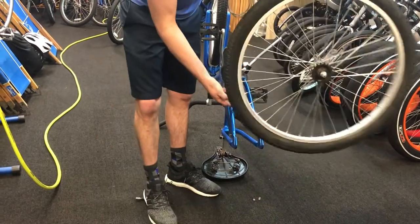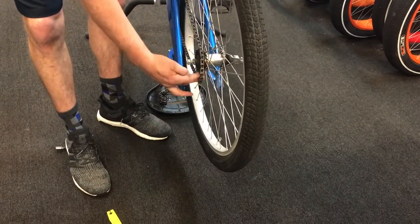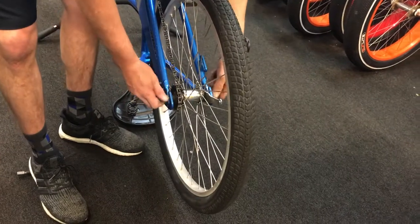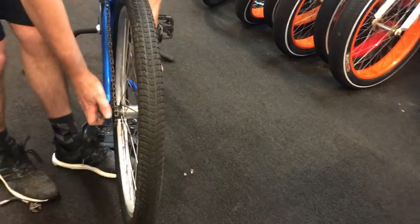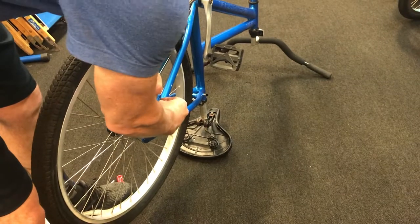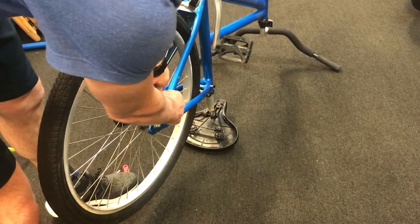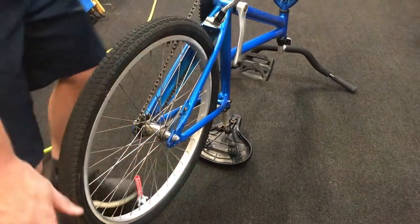Slide the chain over and put the tire back in the bike. Make sure the washer is on the outside of the frame. Tighten these back down by hand. Slide the brake reaction arm into position and then put the bolt back through. Just make that snug for now — don't get it too tight, we'll lock it down after we get the chain tension adjusted.